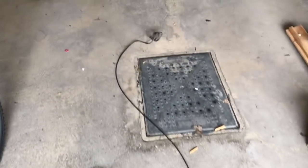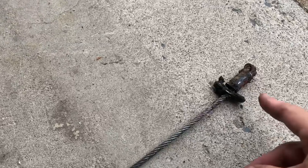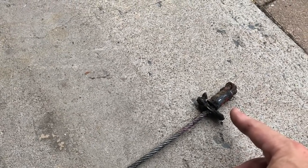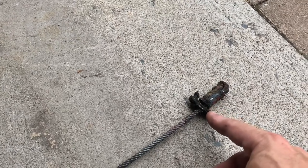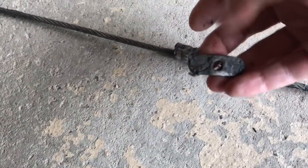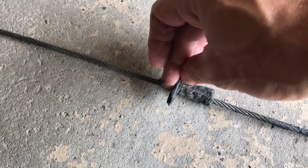I have the cable laying on the garage floor. When you're making your own cable, you're going to want to lay it out and measure the total length, and use it as a template when you put on the crimps for your new cable. There are only two crimps that need to be put on. The end crimp goes into the lower half of the main tube — the main tube is split into an upper half and a lower half. Then about halfway through the cable, you're going to have another crimp sleeve or stop that has a bracket which slides over the cable and sits there — that's what pushes against the springs for the front of the pop-up.